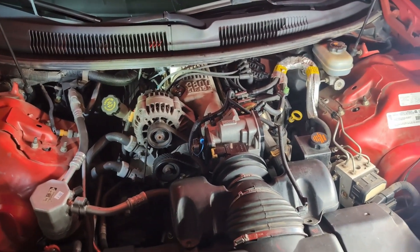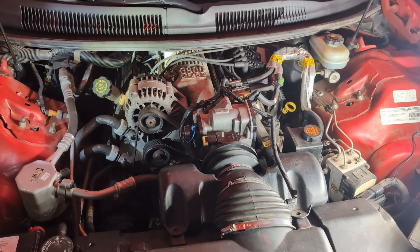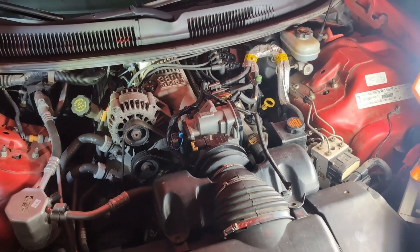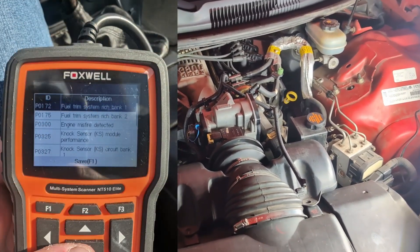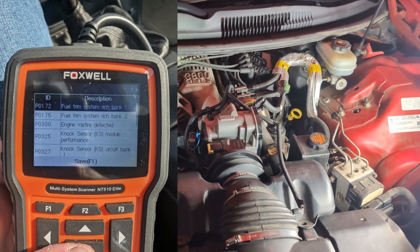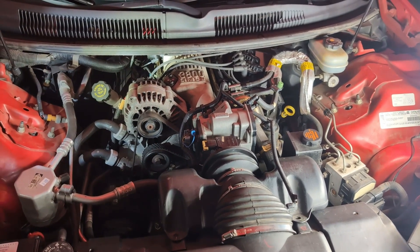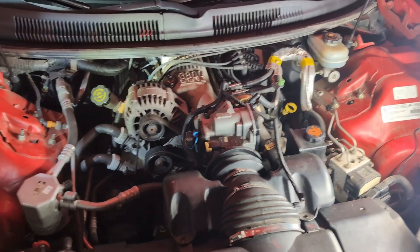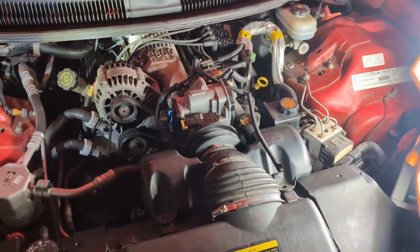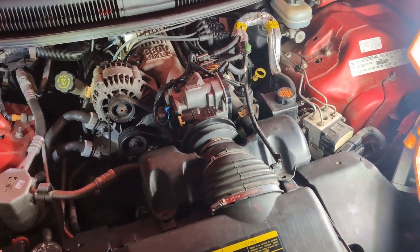Today we're here to replace a fuel pressure regulator. Before I get into what you need to do to replace it, I want to talk about diagnosing it — I'll do another video on diagnosing a rich fuel condition, which is what this car had. I was getting codes for a rich fuel condition along with a lot of other codes. There's a bunch of codes that led me to first think I had an ECM problem. When you get a bunch of fuel codes, especially with a rich fuel condition and O2 sensors, the first thing to do is always clean your mass airflow sensor.